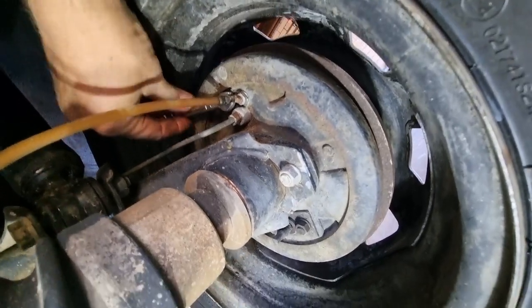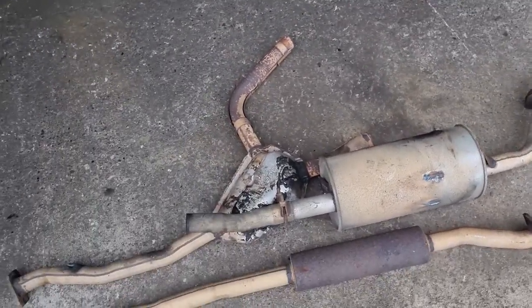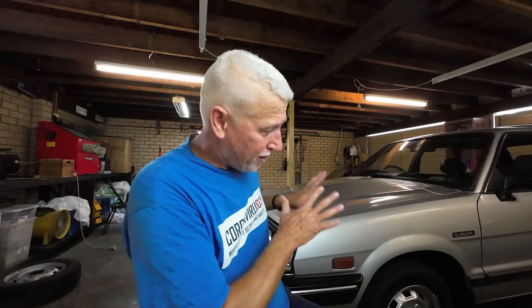I got home fine and just to wrap up everything to do with the mechanical side of the car, I have since gone ahead and done the brakes. I've bled them all. The pads and everything are really good but they needed a bleed because they were spongy as hell — a lot of air and gunk in the fluid. I've run new fluid right through the system. I also got a whole new custom exhaust from Right Price Exhaust at Slacks Creek because the other one was literally riddled with holes. It sounds great at the back but still sounds like a tractor at the front — boxer life. In regards to the tune, it could be a little bit better, but it gets about 440 k's to a full tank. I've done about 600 kilometres. A 440 tank is pretty good — it should be getting around 500. Considering this car has sat for umpteen years, I think that's a pretty good achievement after all that mechanical work.